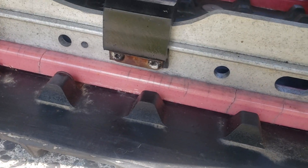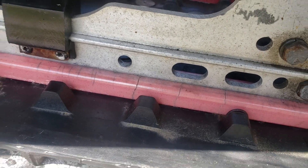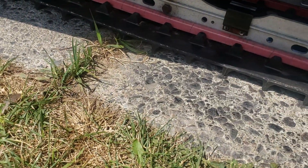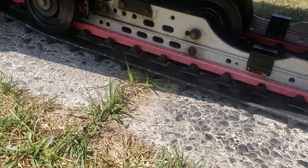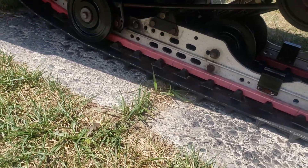I've got some cracks — it sat flat for a couple of seasons in the sliders, but that's wear and tear. I'm going to replace the sliders. I'll pull the skid and do all the bearings in the idler wheels and the sliders, and double-check the suspension.